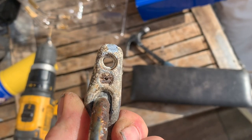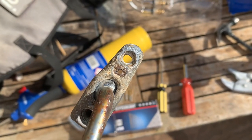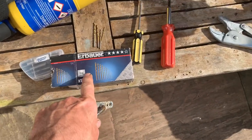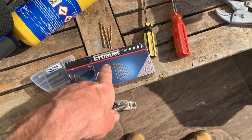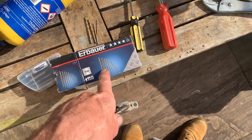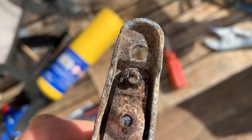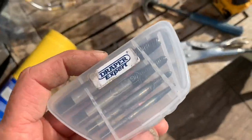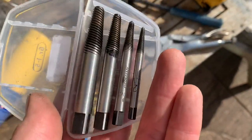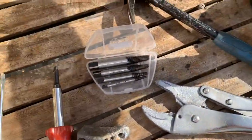These are the sun visors on the project car - they're not SL sun visors, but the actual stalks are the same. Just like the other car, these little adjustment screws here are completely rusted in, so I'm very carefully drilling those out with new sharp drill bits. We started with a 1.5mm, stepped up to 2mm, 2.5mm, and then finished on a 3mm. We've just bought for this restoration a huge box of drills - about £20 for a box - much cheaper, and you ensure you're using really sharp drill bits. Now I'm going to do something I really hate doing, which is using an easy-out to see if I can get the remainder of that screw out.